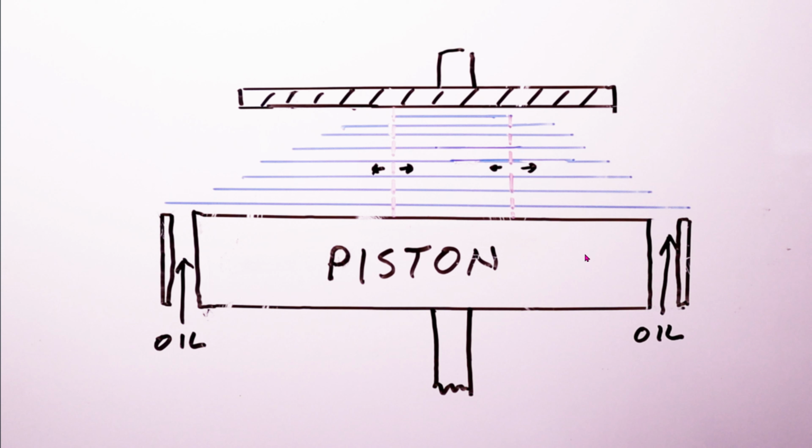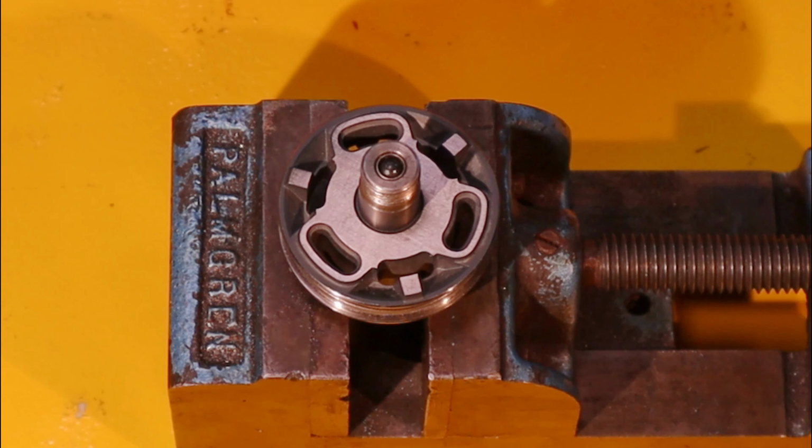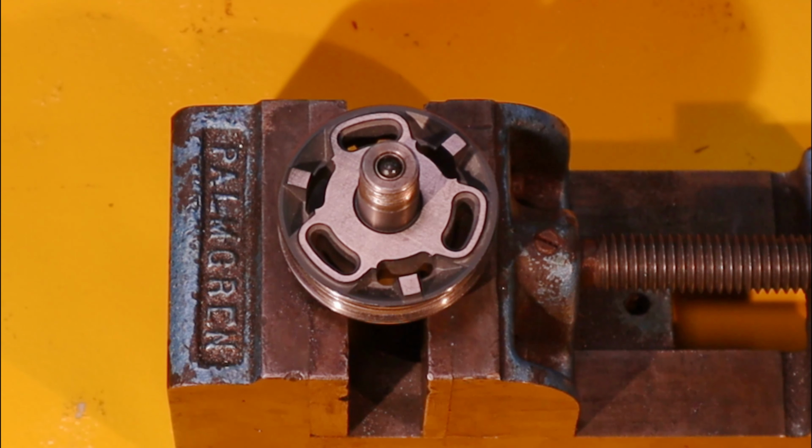are in a little, but this is just a bad drawing. Wonder who did that. So anyway, this is a real important shim, and these so-called professional shocks, some of them only have one size, and that's that. Okay, here's a 44 millimeter piston, Ohlins, probably from a TT44 IndyCar shock from the 90s. Still a fantastic shock, but they don't make them anymore. Very complicated to work on, by the way.